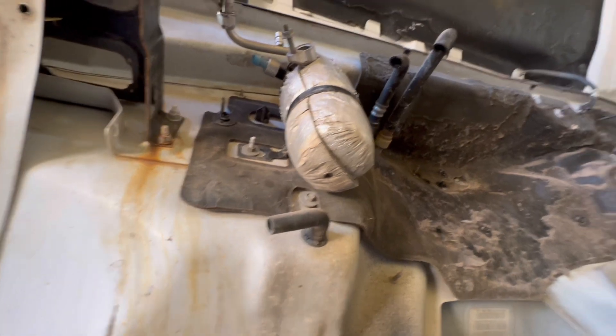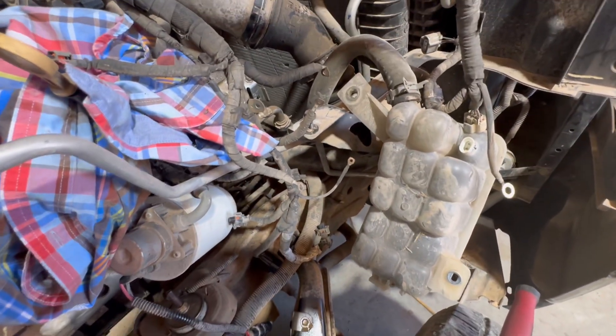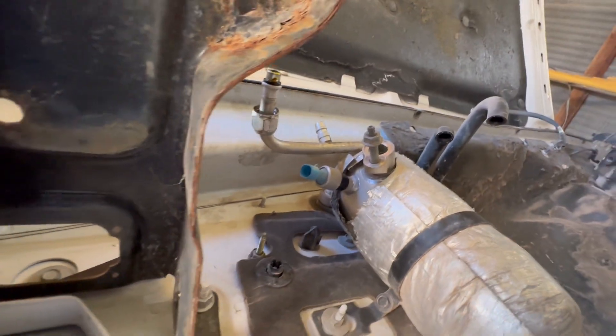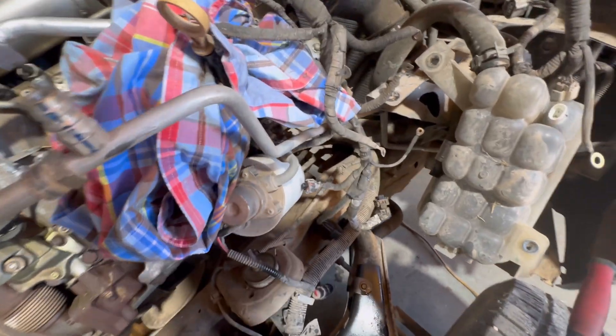As you can see, this hose was already busted so we just cut it off. One won't be reused anyway; the other we have a new PPE lower rad hose kit coming. We're replacing a bunch of stuff on this truck. I like to take the fitting release off the AC, take that fitting loose, take the bracket out — always put the bolt back in so you know where it goes. You can bleed the system here or up top, however you want.